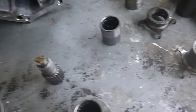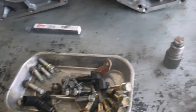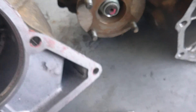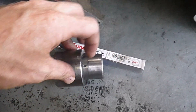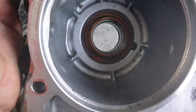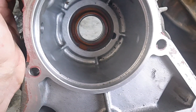Now, interesting — the oil flow on the Lexus. Here's the sleeve off the Lexus. The oil flow actually comes down this blind and feeds into the back bearing. On the Surf they actually come down through the center of the shaft — there's some little holes in the shaft. Here's the sleeve off a Surf; it goes through here and comes out this hole, which then pumps into the dam on the bearing and lubricates all the bearing. It goes through the bearing and once it gets full enough it overflows and comes back into the box. So it's constantly getting a supply of oil.